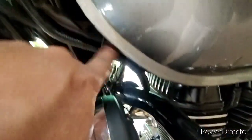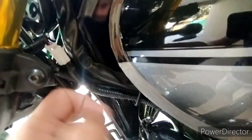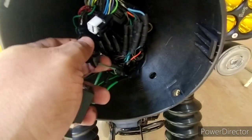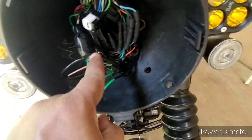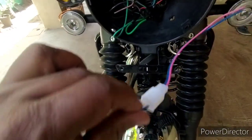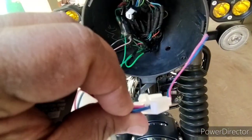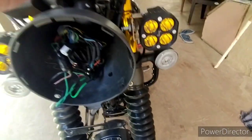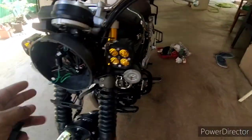I can remove the light separately without removing the entire wiring. Inside the dome where Honda has given the OE socket for the AUX lamps, you'll need a specific socket for the connection. I cut the clip on the top of the opposite side and put tape on it. One of the wires goes to the switch, and whatever comes out, this switch will help with circuit breaking. This is where the main power comes in.